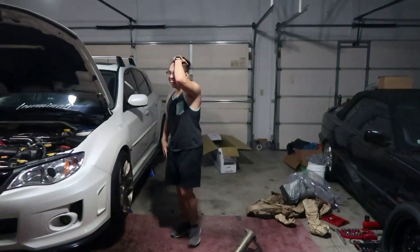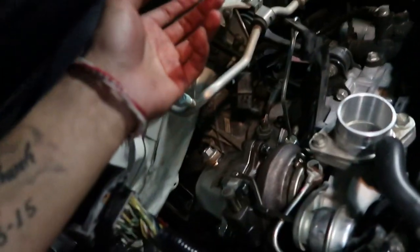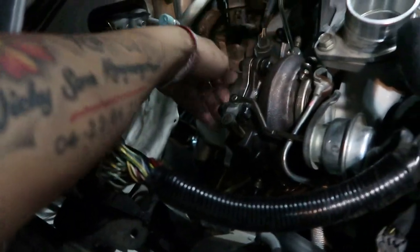Okay, that's enough copyright. So, we decided to leave the wastegate where it was because it looked like it was already grinding down. But now we just put the new catless downpipe on. We have it on. Just need to tighten the bolts right here. And then John and Anthony down there are just tightening the bottom part, putting the O2 sensor back on. So after that, just tying everything back on: intercooler, the piping, blow off valve. Yeah, I think that's pretty much it. Tighten these bolts down, intercooler, see what it sounds like. So, see you guys in a little bit.